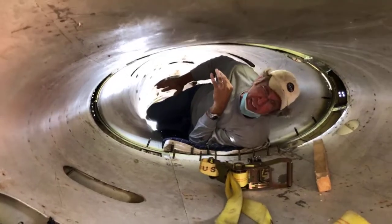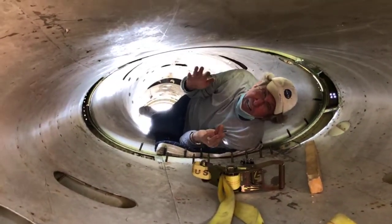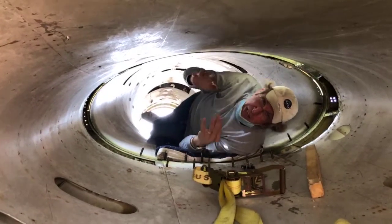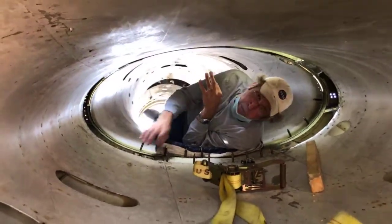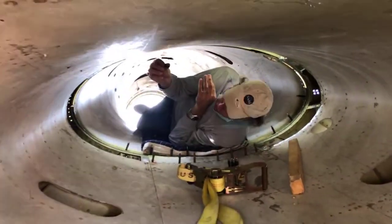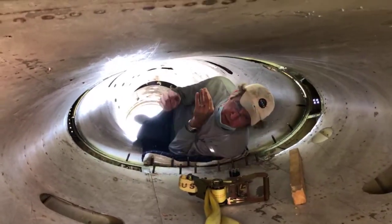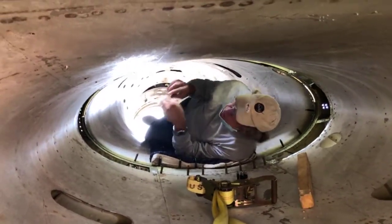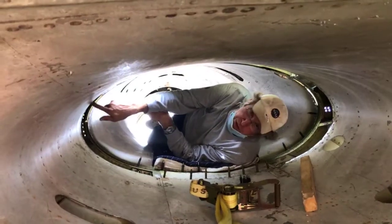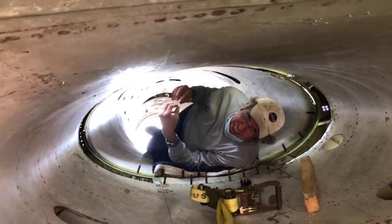You can see from where I'm at, the duct slopes downhill while the other parts of the airplane want to line up straight. So that's where we needed to have the freedom of motion. We took this strip out and we'll be putting it back in. You see these temporary fasteners called clecos that we're using to hold the skin in place until we get the huck fasteners back in. I was also dealing with some fasteners coming through from the outside that I could reach from in here.